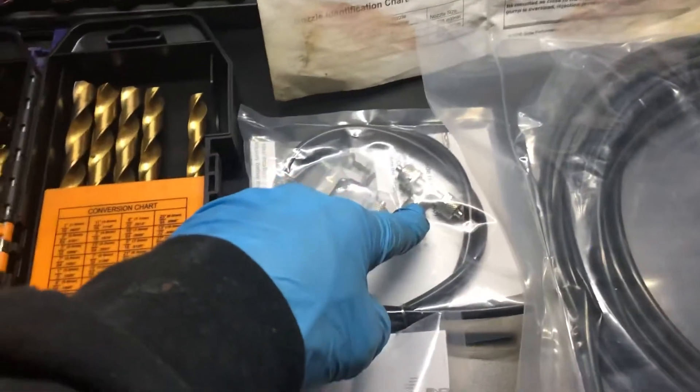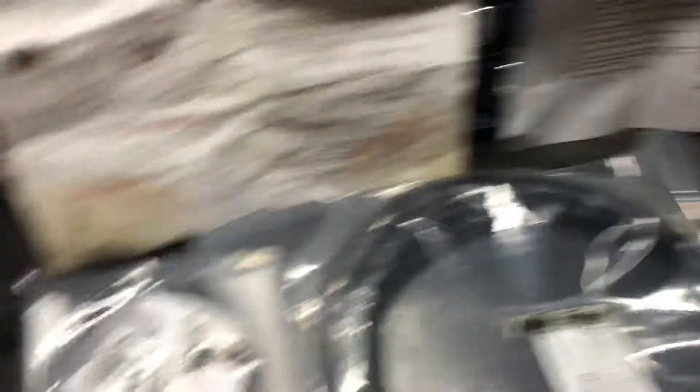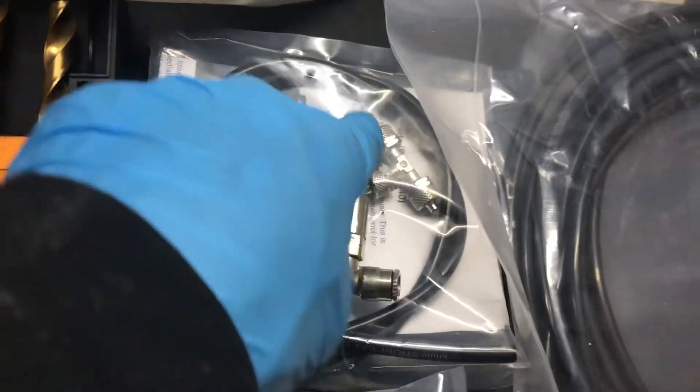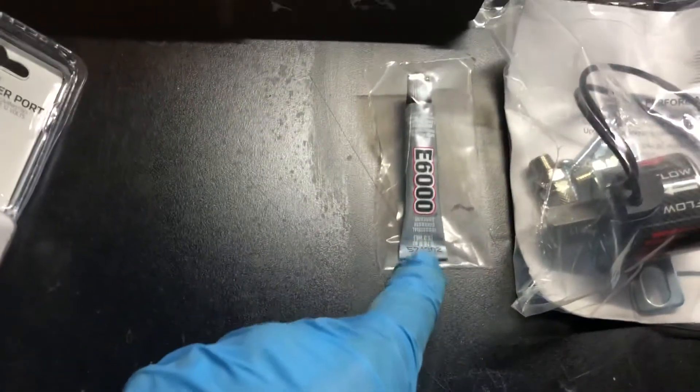You need a tank and of course the line. This is another nozzle right here. This setup is for my diesel — my Dodge 3500 with a 6.7 — so I'm gonna do dual nozzles. There's one nozzle, two nozzles, and the lines can go to both. You need this specific line because it's for methanol — you can't use Teflon tape; supposedly it eats it.